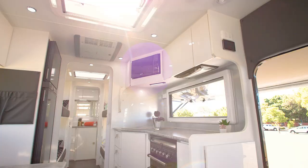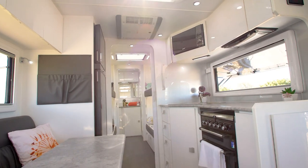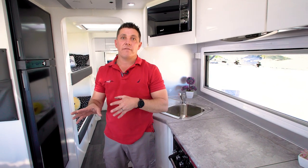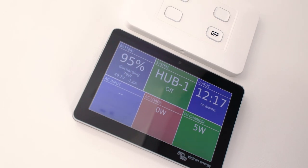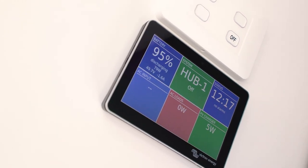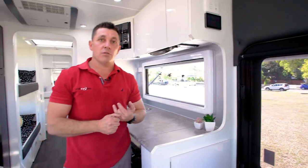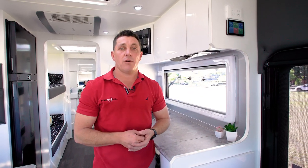The big thing is with this van — it's not only about fitting the whole family in, we've really focused on making it full off-road and basically self-sufficient. That's where the 48 volt step-down system with your 400 amps of lithium and 750 watts of solar comes in handy. That's all operational on our smart hub, so we've got full state of charge, it lets us know exactly what our battery's sitting at and our current charge rate. It's also Bluetooth available, so you can monitor the battery system from outside off your phone on the Victron app.